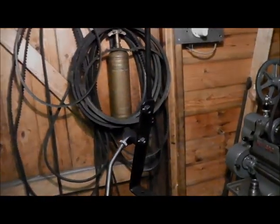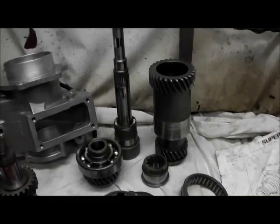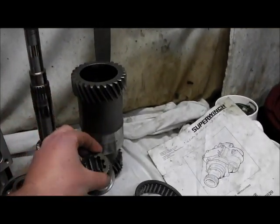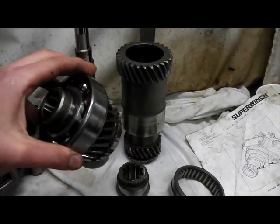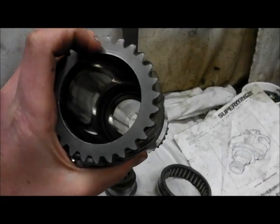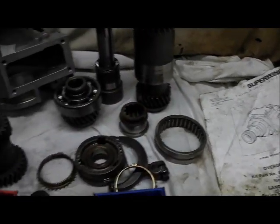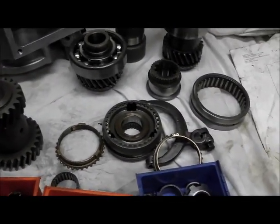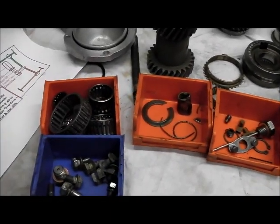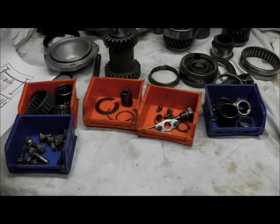So what remains for today is just to show you the parts. That is the main shaft, which engages with this clutch collar that goes on the back of the gearbox main shaft. This is the input shaft with the whopping great ball bearing on it. The output shaft has an oil seal that goes in there - I'll give you detail on the position that needs to be set next time. Then you've got the output shaft bearing, the layshaft, the synchro hub, and the selector fork. All that really remains is to measure up all these bearings and seals and get onto a supplier.